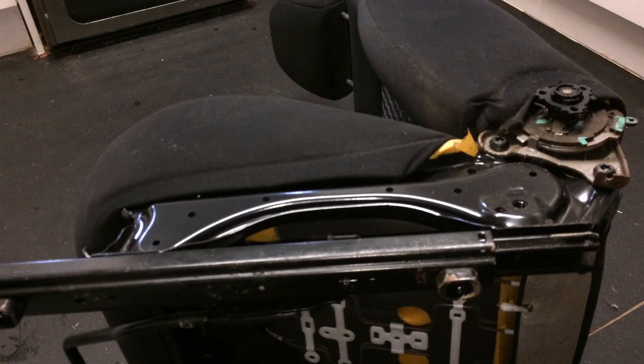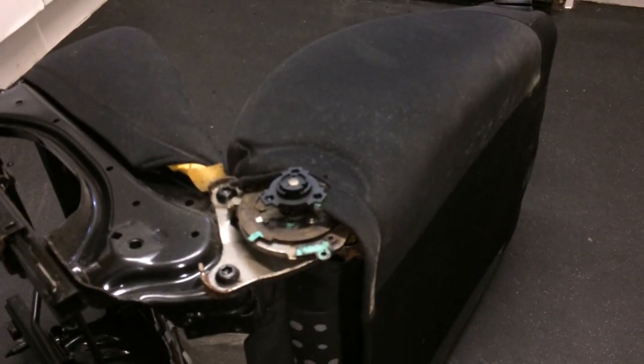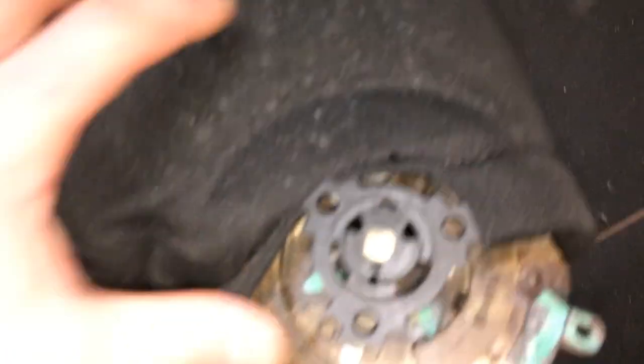Pop the lever — the knob to adjust the tilt — and then the plastic trim piece simply pops off. The bit you want to look at is around where that knob was. Pull the fabric up just a little bit and it'll reveal the end of the cable — it's like a brake cable on a bike. That's your release cable. If you move the handle you can see it move. It's got a little safety clip on it to stop it popping off.